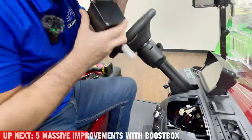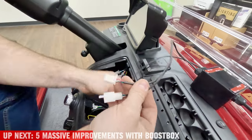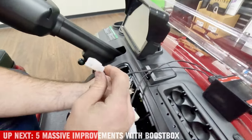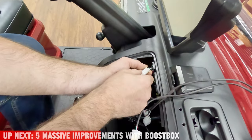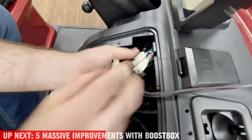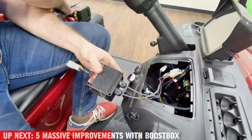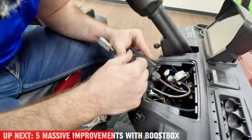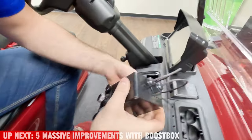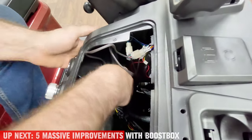Grab your boost box - I think it's easier to just sit it up here. You can't mess this part up - everything is wired in a way where there is only one connector for each one of these to go in. Grab the 4-pin connectors first, the power connectors. Connect the male one inside of the female one on the cart. I'd recommend when pushing this down to push it to one side on the driver side of the cart, because if you ever upgrade to the D5-100, that includes an amp that plugs right inside of this, and the amp sticks down to the right side of the dash.